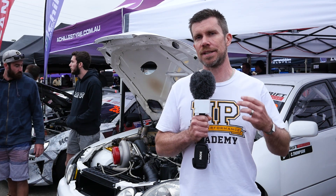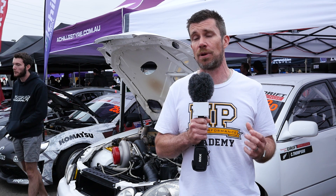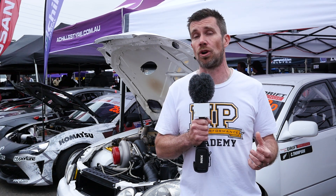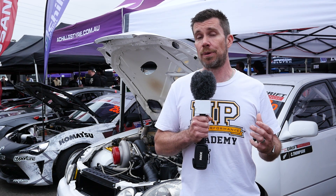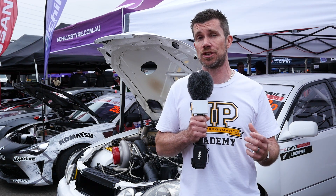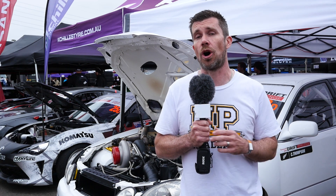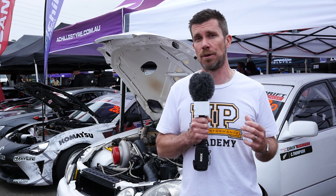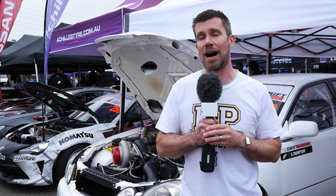This presents a challenge because Waterman mechanical fuel pumps are normally driven either directly by the crankshaft in the engine bay or mounted on the back of a dry sump pump. With the Waterman pump mounted in the boot, Carl needed a way of getting drive all the way from the engine bay to the rear. This is done with a mechanical drive taken off the back of the dry sump pump that runs through the chassis before coming out in the boot, connected to the Waterman pump via a flexible cable.